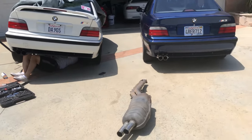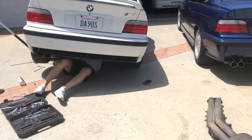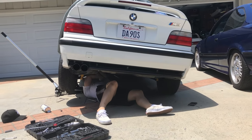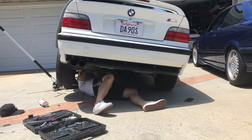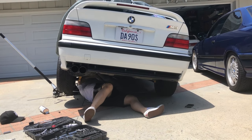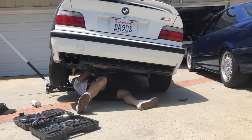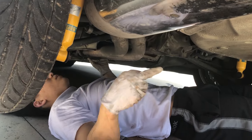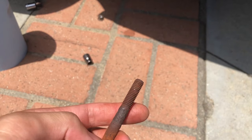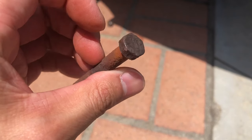Philip's under the car right now. It's just four bolts - two connecting to the exhaust hangers and two bolts that connect the exhaust to the mid pipe. Here's the exhaust that's already on Philip's car - it's an Active Auto Works exhaust. It sounds pretty nice, just super quiet, barely louder than stock. All my bolts are original, they're all rusted on - it's gonna be pretty annoying. If you've ever taken off an exhaust you know exactly what I'm talking about.